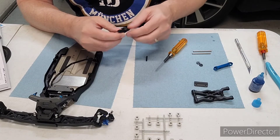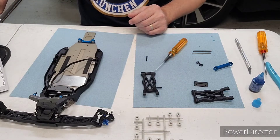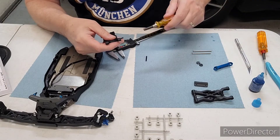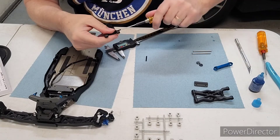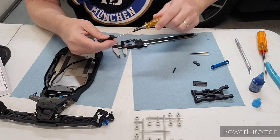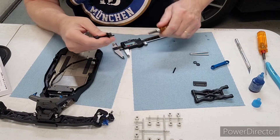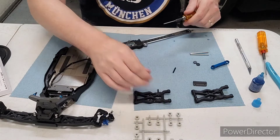You just put the shock on here and then put a nut on — super nice. The manual says you should have 11 millimeters of this shaft sticking out. This starts to get a little tighter once you get to the point of hitting 11. You could also pre-mark this with a Sharpie to make it a little easier. So we get 11 there.